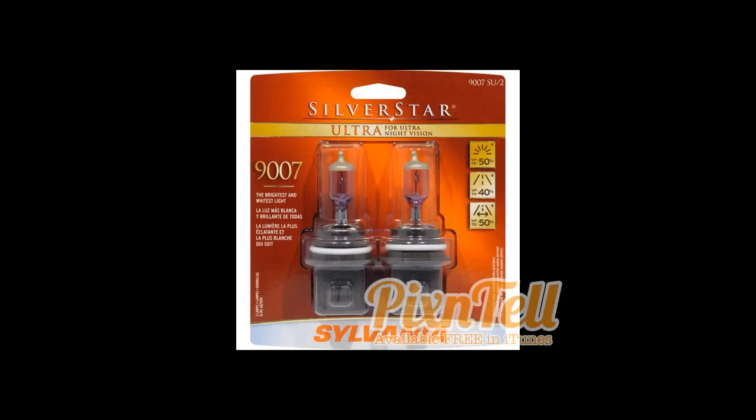If I were you, I'd change the bulbs in pairs. That way you don't have one light that's brighter than the other, or a different color light. And also, if one went bad, the other one's probably the same age, and it'll be going bad soon too.